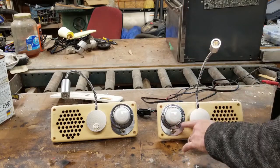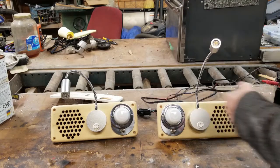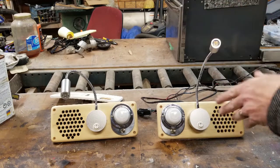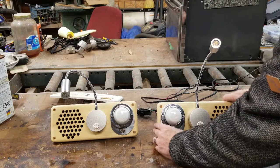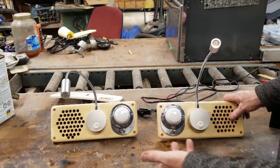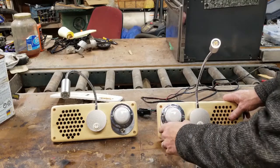I wired this differently. I don't even know how the factory wiring worked because the switches on my motorhome were messed up. So I came up with this, which is basically an on-on single pole double throw switch — effectively just like your three-way switch in your home. And I wired it between the two.